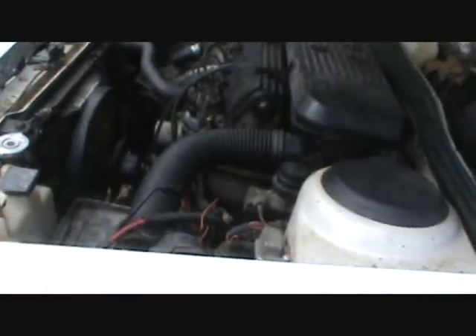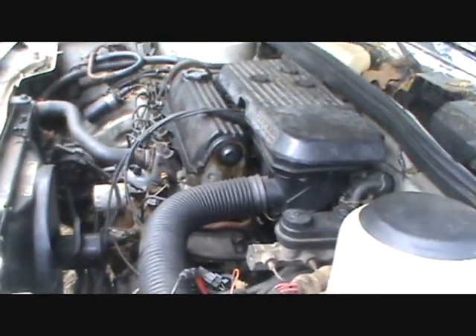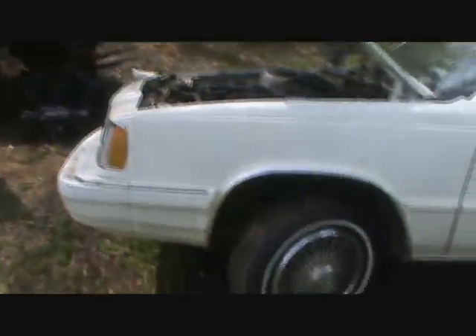I've got it jacked up to do that. I'll try to hit the highlights and document as many steps as I can — this car's got to run, there's no place for non-running cars here anymore. Let me crawl under and take a look at what we're dealing with as far as the exhaust goes. This exhaust has already been worked on before — there's been a leak in it, and I can see where it's at right there. Looks like the converter's been cut open up there too, which doesn't surprise me.